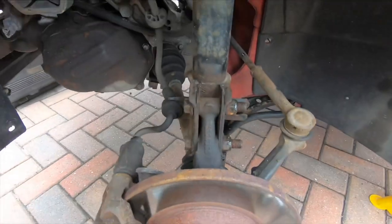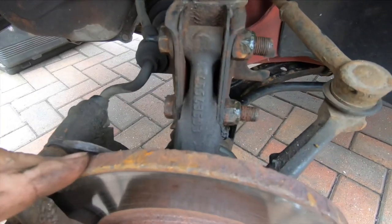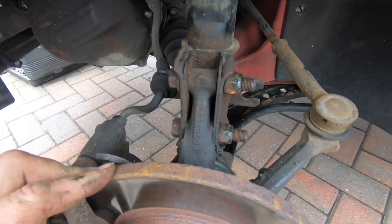And I'm going to take the front wheels off, and get the front shocks out, chuck them in my Golf, and then wait till about 5-ish, and hopefully Slick can help me take the top mounts off. And then I'll come home and put them in, then that's the Fiat done. I'm going to measure this now, and I don't expect it to go down much, but obviously it'll settle all the time. It was 600 before, so I'll lower off the jack and give it a quick measure and report back. Okay, so we've got 19mm there and 18mm on the other side, which is really handy.